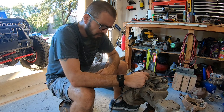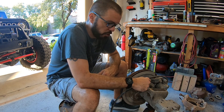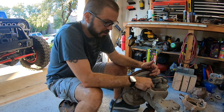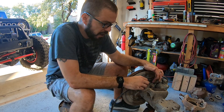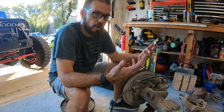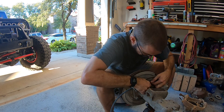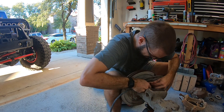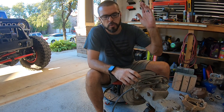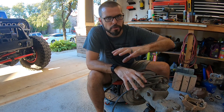Once that's removed, you have a spring here that holds your emergency brake cable onto the little arm that basically opens the shoe. The way you're going to remove that is by pulling back on the spring and then unhooking it from that arm. You can do that with a pair of pliers or just with your hands. You're going to have to do that again on the other side, and then you can take all these cables and throw them in the junk pile.